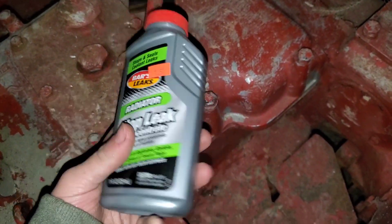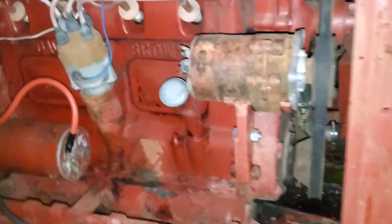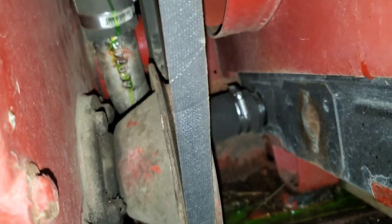There's also some leaking at the water pump, which is concerning. Don't throw a whole bunch of stop leak in there because that's how you ruin motors — it'll overheat cylinders two and three. I'm going to tighten that up. I think it's actually coming from up there and running down the back, so that's why it looks like it's leaking down there. I stuck my finger there to check the flow.